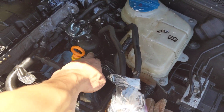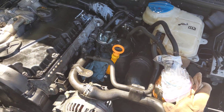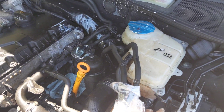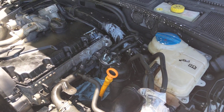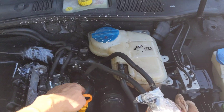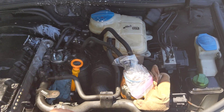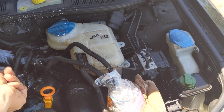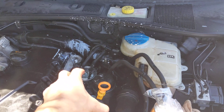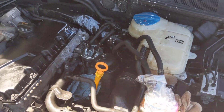The oil filter — taking that off can be a pain in the butt. I used a pipe wrench, which did actually work, and then I hand tightened it back on. So far nothing has leaked out. I would kind of like to have it a little tighter, but how O-rings work, it should deform, especially under pressure, and further seal it, as long as the O-ring is inside that cartridge enough. When you go to change your oil, before you drain the oil, you should loosen the cap on your filter if you're going to replace it. Loosen the cap, pull the old filter out a little and jiggle it — the old fluid will go down. Some people suck the fluid out of these cartridges, but if you just unseat that old filter, all the old fluid goes down.